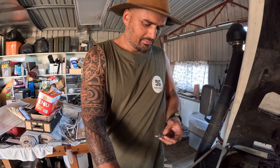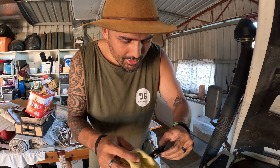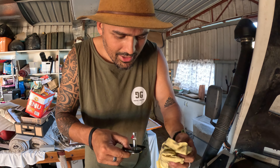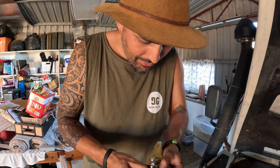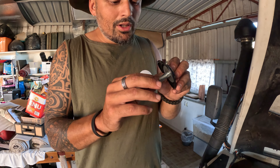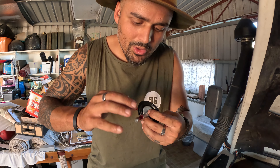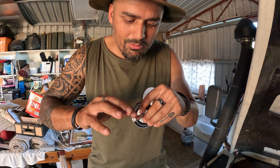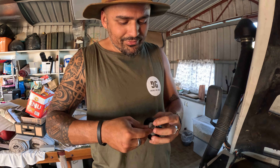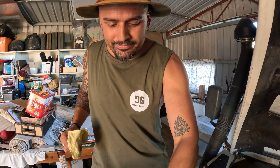We can do this now and do the rest later. I'm gonna show you in a second. Anyway, let's replace this one. There's some dirty stuff — I don't want any of this bad stuff going in here because this one is a diaphragm, and it needs to be nice and clean because the diaphragm works with air vacuum. So after that I'll just put a little bit of grease, just where the pin is gonna go, rubbing all the time — not too much, but just enough. I don't like to put metal against metal without any lubrication. That's really important.